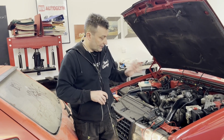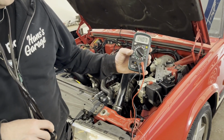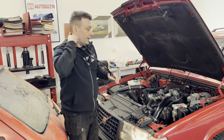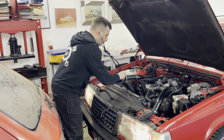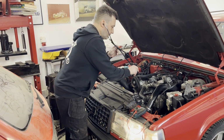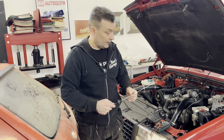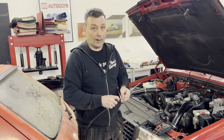Oh yes, it started well, and now the charger is charging 14.07. That's good, but you can probably hear the noise, the squeaking noise, and I use my stethoscope. First the water pump. It's fairly quiet, but the alternator, it's very loud, so I think it's the bearing, because it's charging okay, but we have one more project